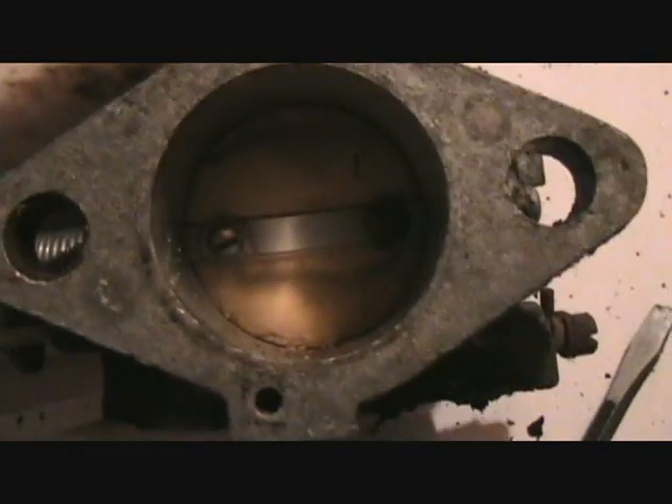Here's an update. This old parts carburetor has lots of crap on it — look at what's coming out. I had to use a screwdriver to break the sections apart. No wonder this old one probably never would have fired up. Just goes to show you to take care of your stuff. Looking at the carburetor kit that was put into the '69 — the one that's supposed to be up and running — it is running, but not enough. The diaphragms from the kit were put in backwards. Also, when I was taking it off, I found a penny shoved inside from this side. I'll put the seals back the right way and see what she does.